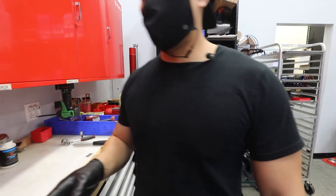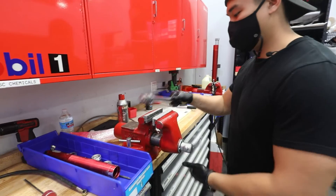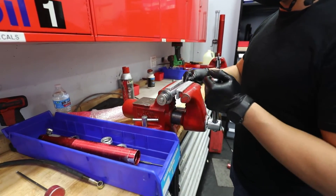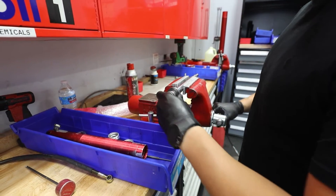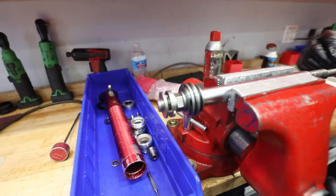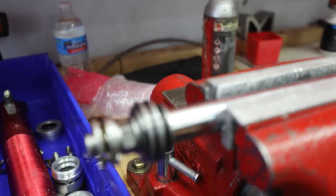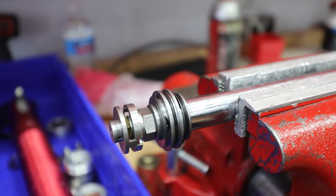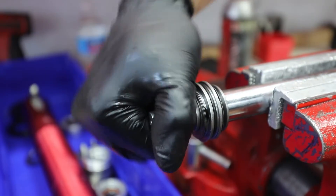Now that we're doing a conversion on this one, we're going to have to look at this old piston rod and disassemble just this piston rod. If you come here a little closely, this rebound is pretty messed up on here. I'm going to assume that the top of this is unthreading. So once I disassemble this, I will go ahead and clean the threads off and put some red Loctite and make sure it's super tight, because this rebound rod is going out that way — that's why it's seized right here.